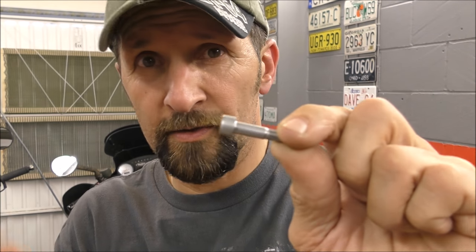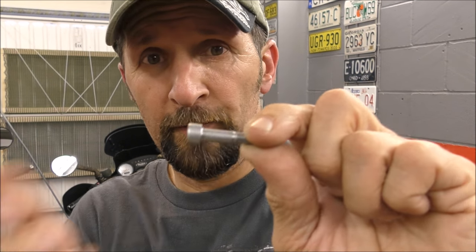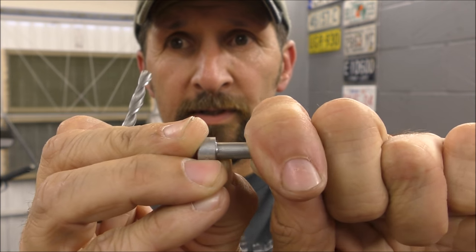Then the casing, or whatever you're trying to get off, will just be able to be removed, and it will expose that much stump. You can get a pair of grips on it, or a stud extractor, or whatever, and you can then remove the thread. So that's quite easy. If it's a fastener bolting something else on, then that's easy.